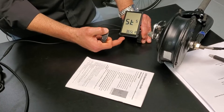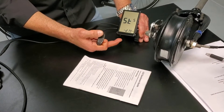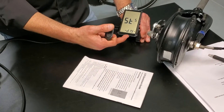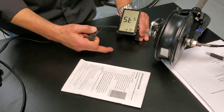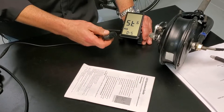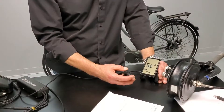We also have 36 SLA, which is old school, and 48 SLA — we left those options in because it's been done many times over the years. The fifth option for battery is DIY. When you get into DIY, it's up to you to do a voltage curve — that's a little more complicated. You would need to know the discharge curve of your third-party battery. That feature is really unique to eBikeKit.